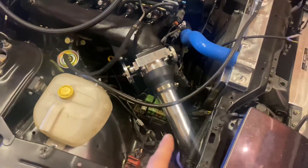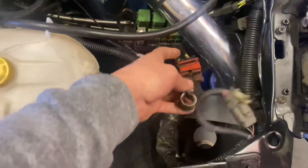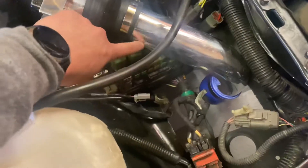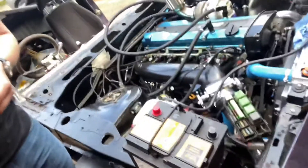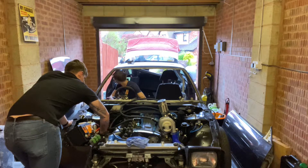To start it, I've got the interior wiring loom and arch loom connected down to the fuse box. I need to get a fuse box cover. Got all the battery connections in here ready to go. That's an IAT sensor but I need to get the bung welded on — when I send the car to get a custom exhaust done, the guy's going to weld on the IAT bung for me as well. A few of the lads are here to help. We've put fuel in it, put oil in it, got a battery rigged up with makeshift cables. Going to prime with oil — pulled the fuel pump plug to prime with oil.